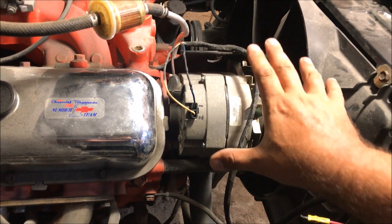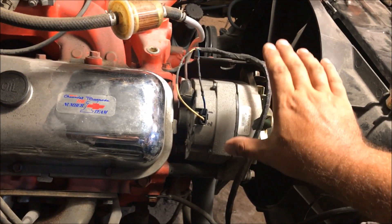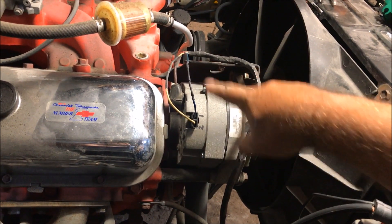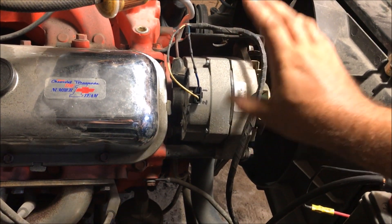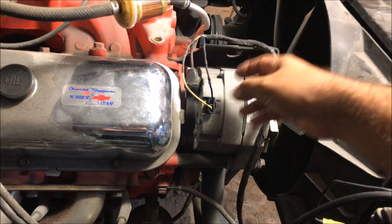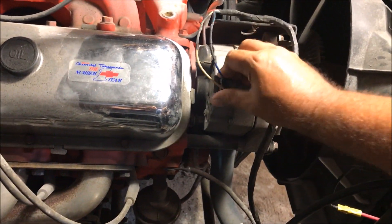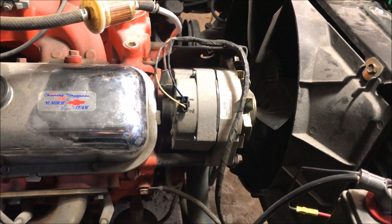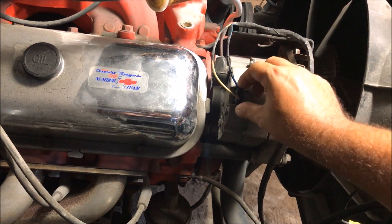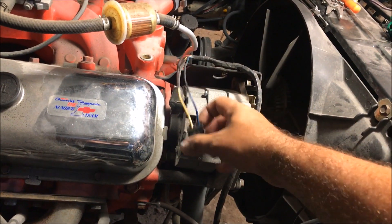This is a typical situation on most cars — a 70 Chevelle I've converted to an internally regulated system, and that's how the wiring will be on your car. They say it's going to clean up the engine bay, and that does make a lot of sense because you only have one wire going to it. But you really need to understand what you're going to sacrifice by getting the one wire, because now you're not going to have your charging light feature.